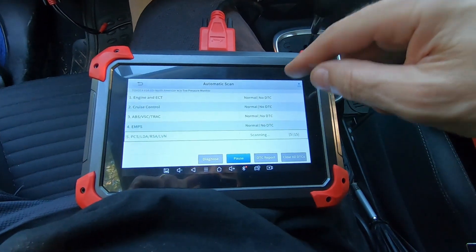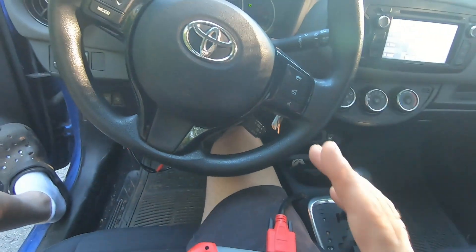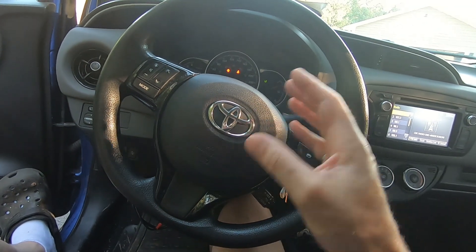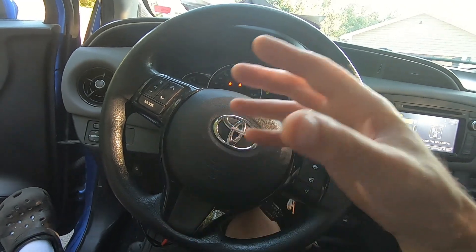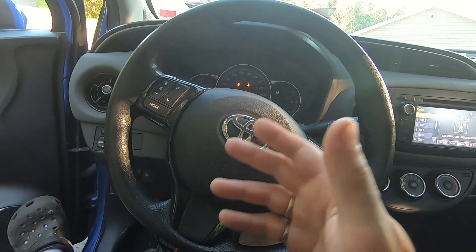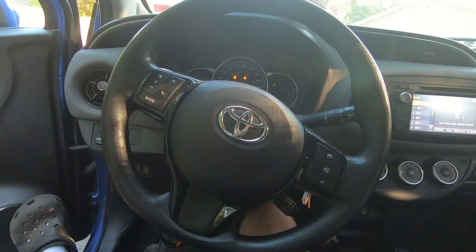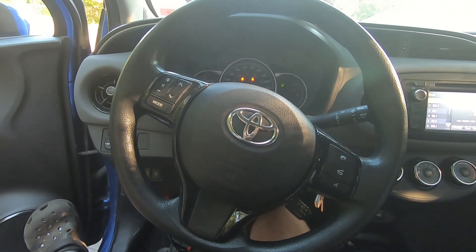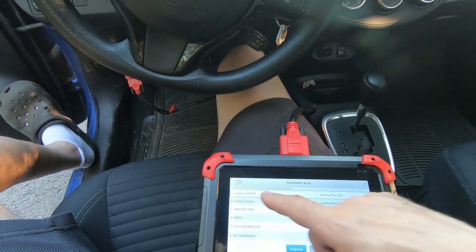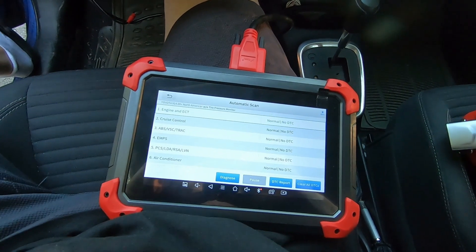With the fuel cap tight, I think we're in good shape — no DTCs. Going back in for another automatic scan — no DTCs for the engine, so that problem appears to be resolved. It's possible the computer does a full scan once you're driving at operating temperature, so the check engine light could theoretically come back on. But given the cap wasn't screwed on properly, I'm absolutely certain that was the contributing factor. I just wanted to share how you can use the D7 tool to read codes and resolve — or at least identify — a loose gas cap problem. Good luck with your do-it-yourself projects, and if you like my videos please subscribe.